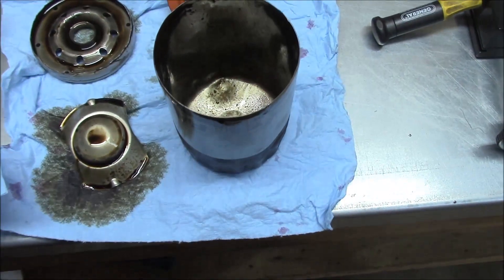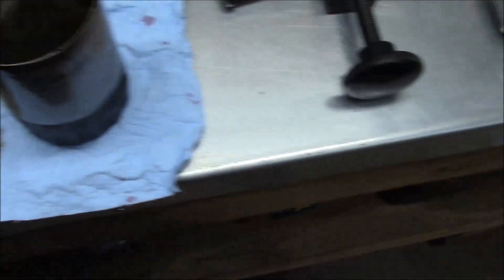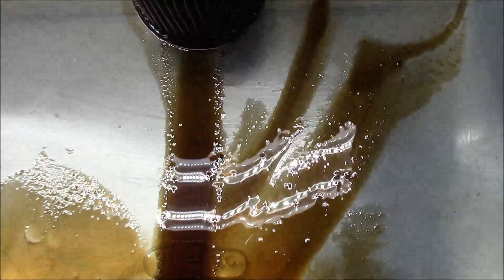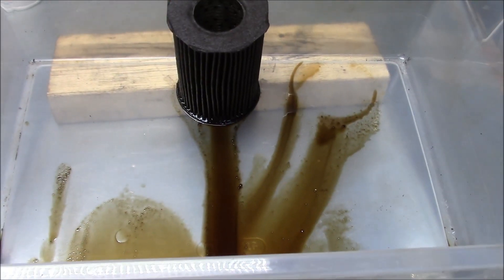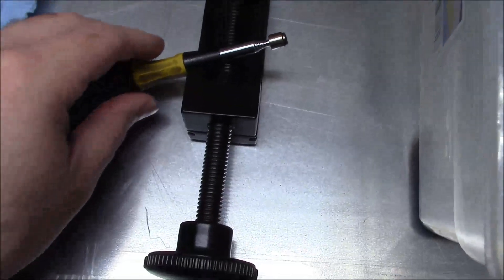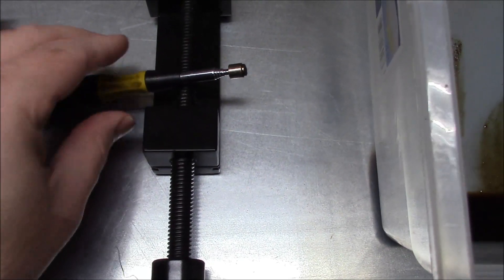The plug adapter is on with a new oil filter. But first, let me show you something — I went ahead and cut the old filter open and it is not looking good. There's a lot of trash in the bottom. You can see the trash dripping off the filter, and as I spread the pleats there was plenty of trash trapped in there too. Things are not looking good. Some of it is magnetic, but not all of it.